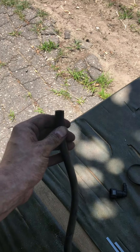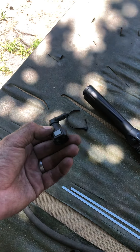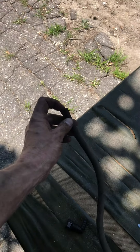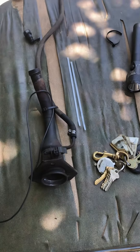This here is a sensor. The original one on my truck had a male piece that stuck out, but the replacement part had a different fitting. That's no problem — there's a piece underneath that you need to slide the male piece into. You simply pop this off the new piece. I had to cut my old hose to get the piece out, but it slid into the new one and no check engine lights came on.